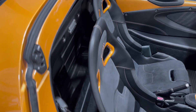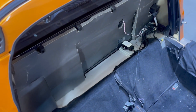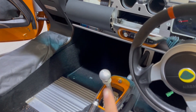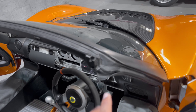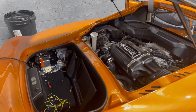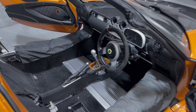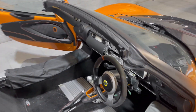We had a listen to it and now we're starting by stripping the car down. The carbon seats have been fully removed and we've got the back panel removed as well. We're doing a bit of fabrication: mounting the sub and amp, adding speakers on either side in the rear, and replacing the unit with the big nine-inch touchscreen featuring Apple CarPlay and Android Auto. In the boot we've also got a lithium battery mounted on the side keeping everything topped up while we work.